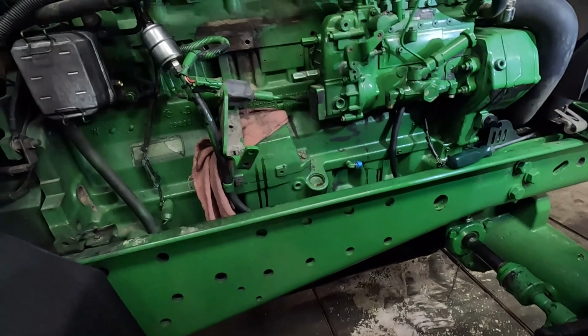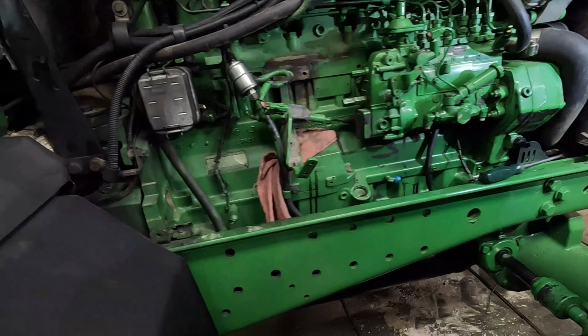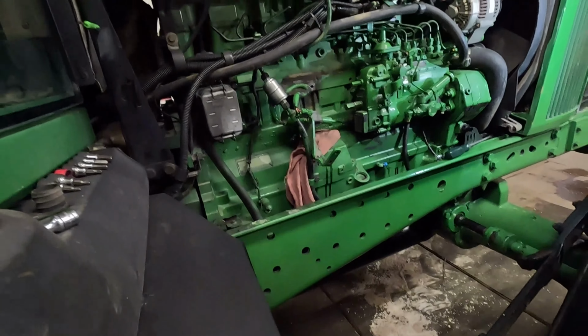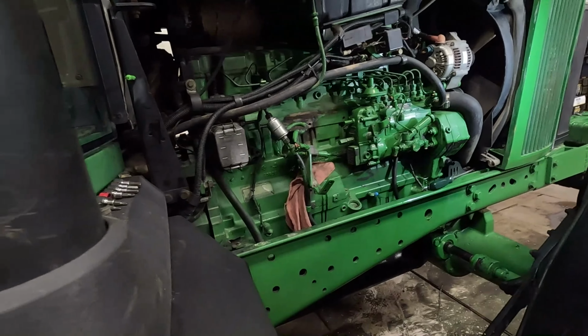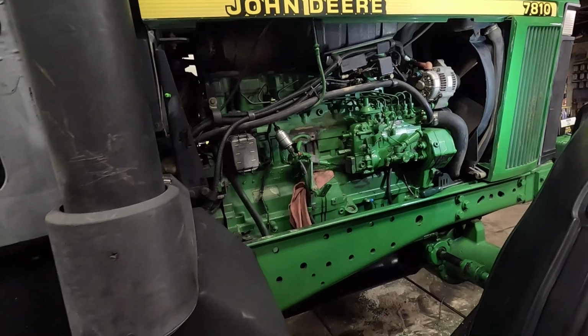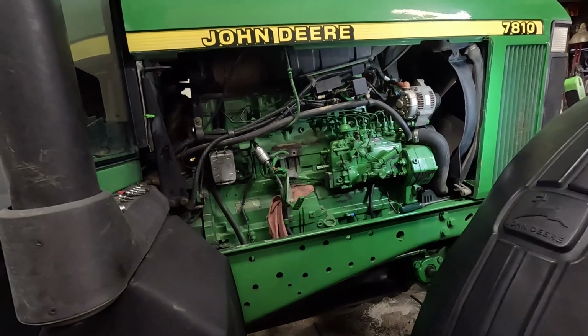Okay. And I might put new tubes and O-rings on that oil filter, because it looked like it was leaking. It just was like wet. But yeah, that's a real pain to get that bolt out of that shutoff solenoid, so I might just let it hang there.